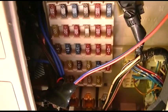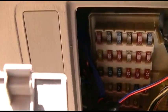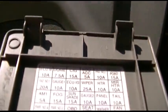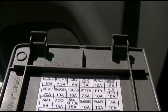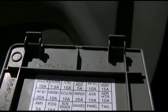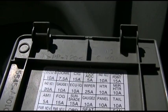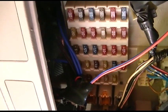You'll find them in this little kick panel over here, right under the vent on the driver's side, and of course there's a legend here. There's in the second row, second column, gauge one - that's a fuse you want to pull and meter for continuity. Third row, fourth column, gauge two - check that one. Maybe panel, just because you don't know what it is. Check all the fuses. I actually metered every fuse in the box here, and everything is perfectly fine. But still, I get no gauges whatsoever.